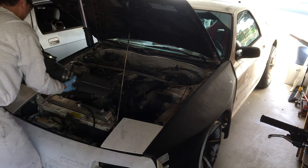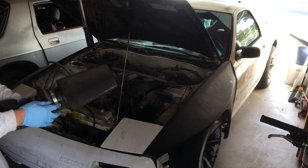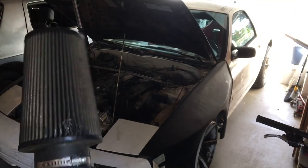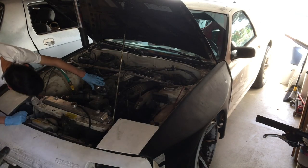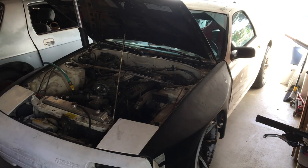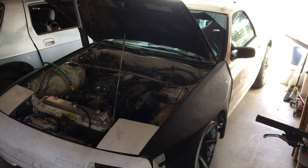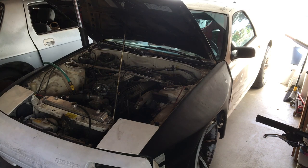This is a limited edition intake elbow — I had to buy this. It was kind of deformed here. Look at the filter — some damage to the filter too. This is a K&N. It's got some damage on the bottom. This is called the 1LE intake manifold elbow, which was kind of a rare thing. They still have it on the Camaro nowadays — the Z28 or SS 1LE. The 1LE is basically the racing package. The stock one had an extra tube coming off the bottom called the Helmholtz resonator — other people called it the donkey something — basically to control the resonant frequencies coming out of the engine so it didn't vibrate.